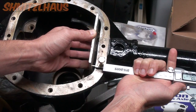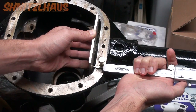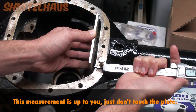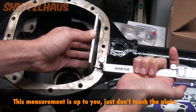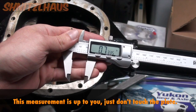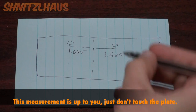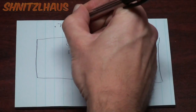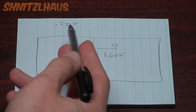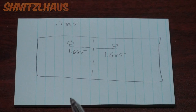If we took our measurement off this, chances are the spreader plates are going to come really close to contacting the carrier when you install it, so just eyeball what you think you'd like and use that as your reading. For argument's sake we have 0.7335. We measured our depth and came out with 0.7335, but we need to know the center of that, which takes into consideration the diameter of the bolt again.